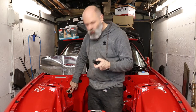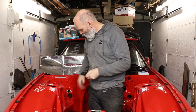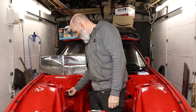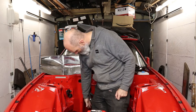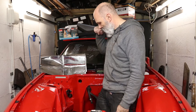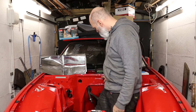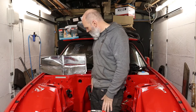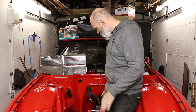I've cut a new gasket out of carb material - gasket material that's oil and waterproof - just to stop moisture from getting through. That's all ready to go. I'm going to do this section here, probably along that side, the exhaust side of the transmission tunnel, and see how much I've got left. The first order of business is to get this up around here and cut it into shape. Then once that's done I'll start peeling and sticking, because it's quite particular about the way it goes on - not getting air bubbles and things in it - so I need to be a bit careful.